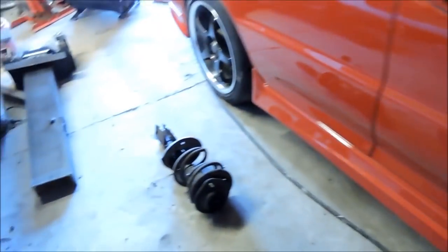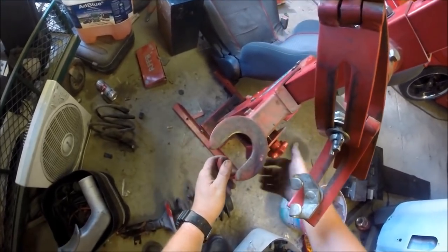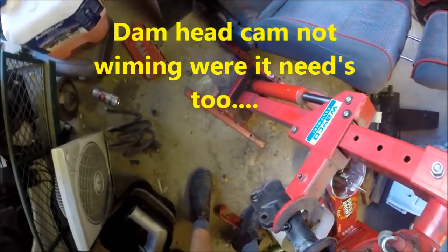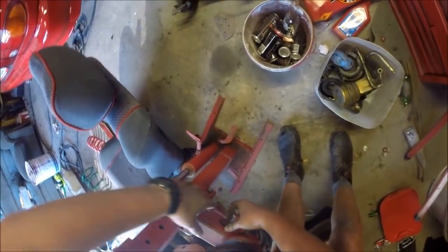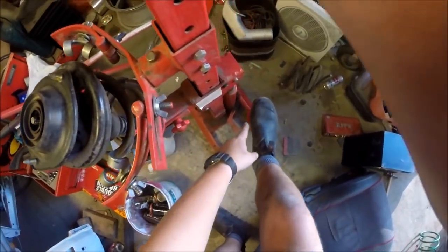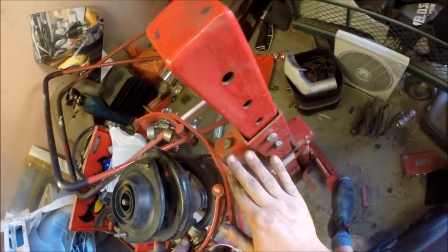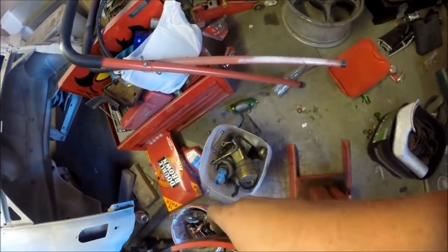We've removed our strut, sitting over there. Now I'll show you how this spring compressor works — paid $50 for it. So good score. There's my spring that we cut in half, as you can see — it's in two pieces. This just sits in here. This bit goes over there. Put the bolt back through. Then as you pump this pedal, it pushes this up. So you hook these on your spring — this pushes up, this stays there. It compresses the spring for you, so it's heaps cooler than just your average pair of spring clamps or compressors.